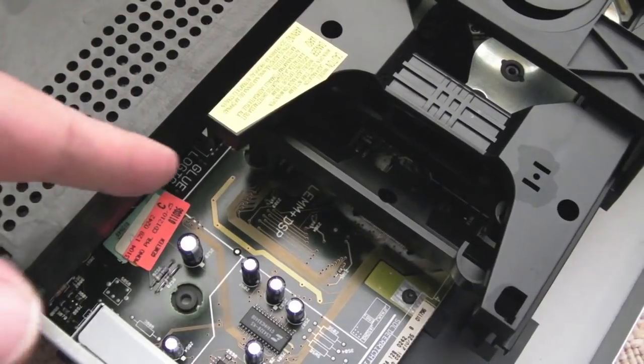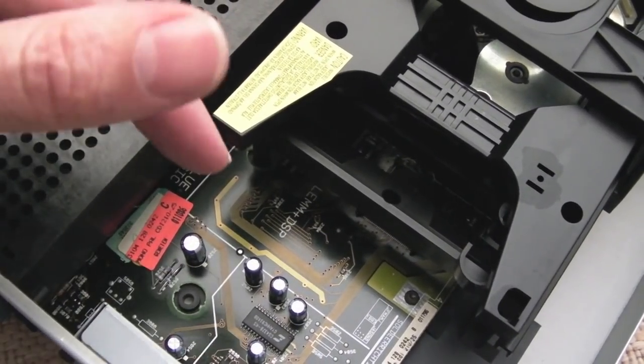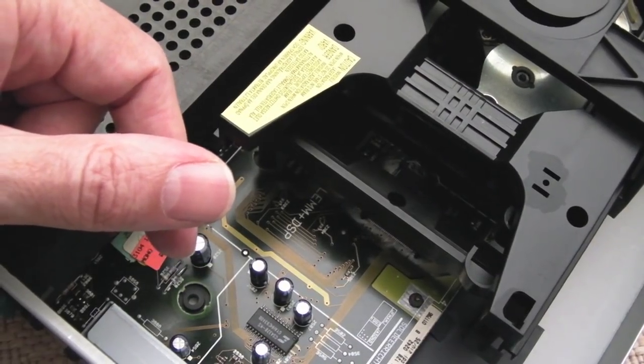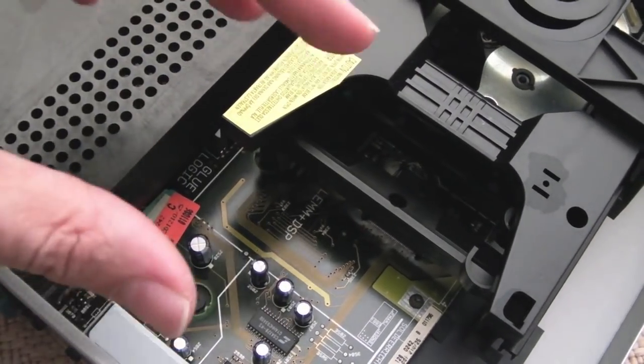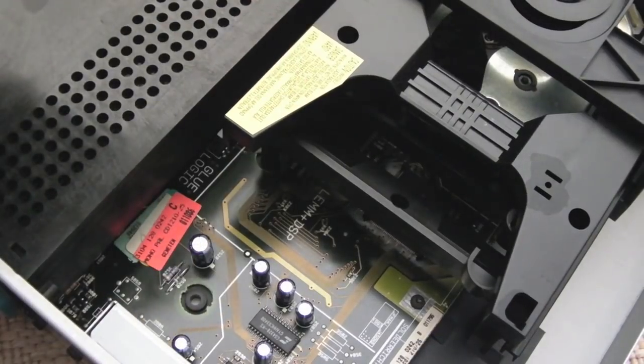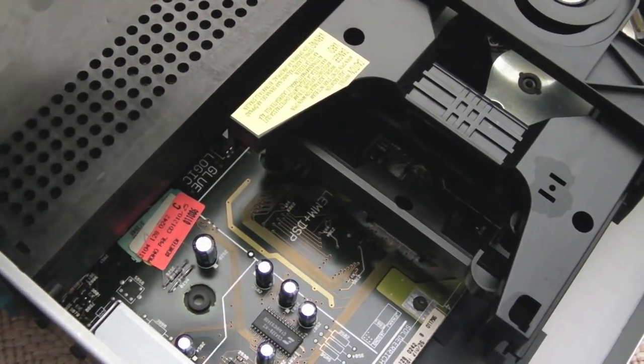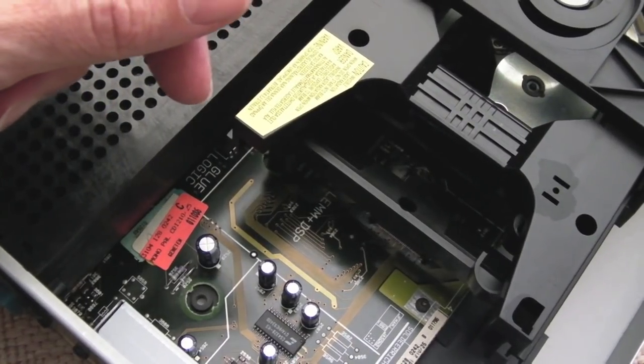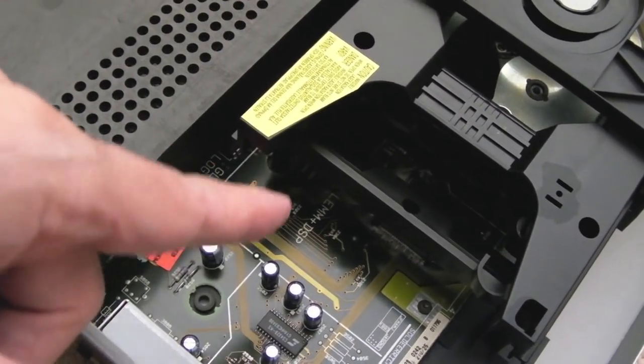They used to replace those Dallas real-time clock chips a lot in some of the older PCs. Actually, I'm trying to think, Compaq and Digital PCs. They always had those Dallas DS1287, I think they were. So it's very common to need to replace them, even after only 5 years, actually, back then. So without a doubt, it'll need replacing in this.